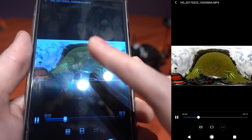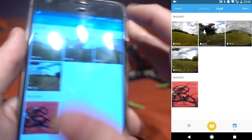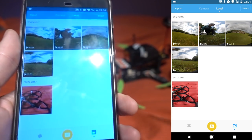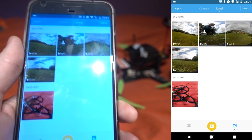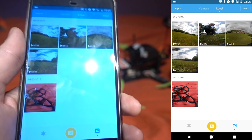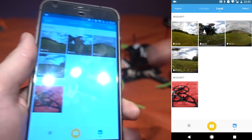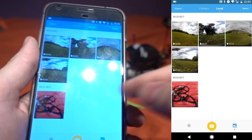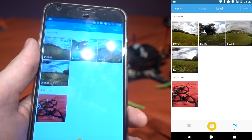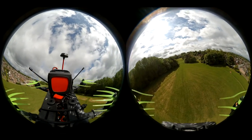Downloading over Wi-Fi takes some time, so an alternative is to take the SD card out of the camera, put it in a computer, and copy the files over to your phone — it's a little bit quicker. There's a folder called something like MAD360 or MadV360 that you copy the files from. You can also import files manually using the import button. The reason you can't just take files directly from the SD card is that they're not stitched — they appear as two massive round fisheye videos. It's the phone's software that stitches them together.